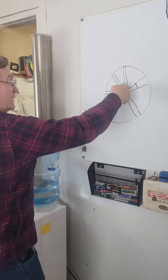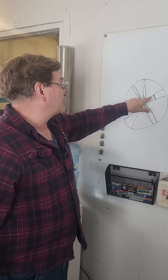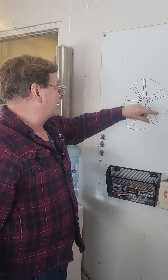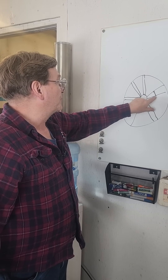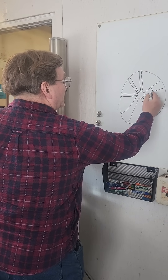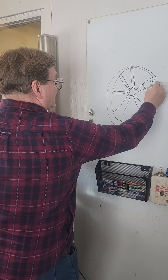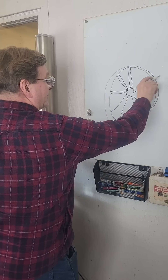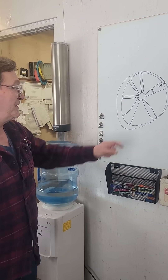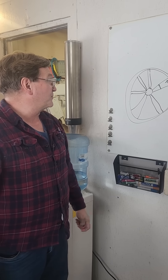The question was about a spoke that was broken through like that — you see this a lot of times on older stuff. About brazing it: I saw some brazing videos and I really don't recommend this, because as you heat this up, it pushes out here, and what normally happens is the outer rim will just break right here and explode away in one piece or two pieces. A lot of times they hit people — they come off with some pretty good force.